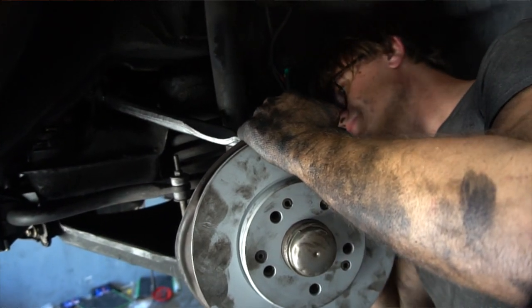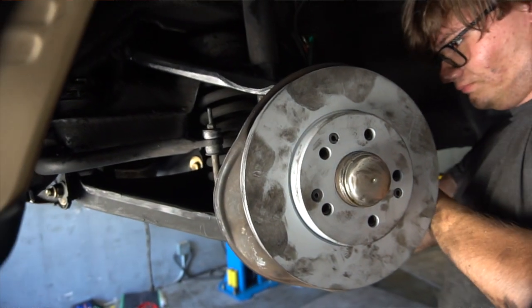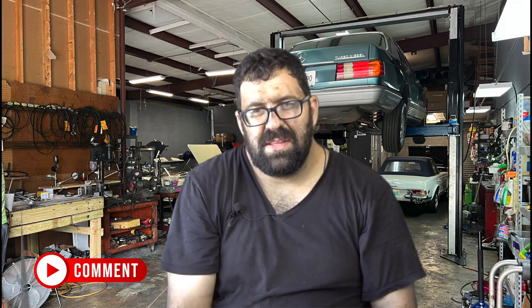That's very dangerous. Once that's done, and your engine is firmly supported, you can undo things like the tie rod, the brake caliper, brake line, ABS sensor, or brake wear indicator sensor. Then, finally, your two subframe mount bolts. I'll usually loosen the subframe mount bolts on the left to the right side, then pick the side I'm going to do the repair on, remove them all the way, and gently lower that side of the subframe down enough so the jack barely supports it — and I can get in there and change the engine mount.